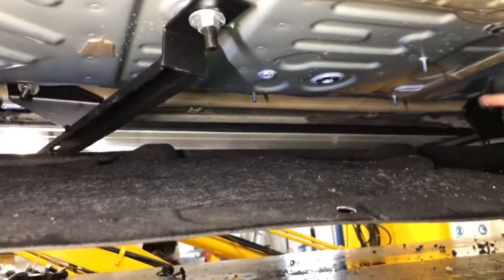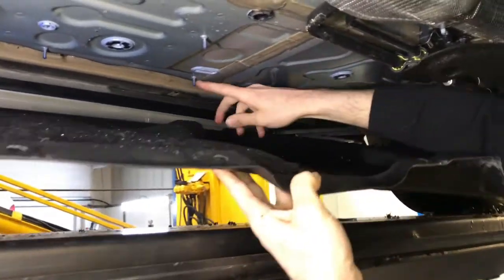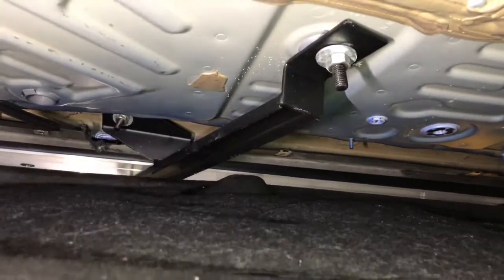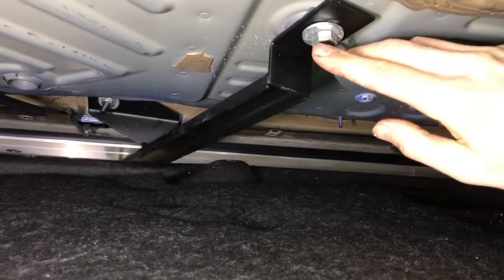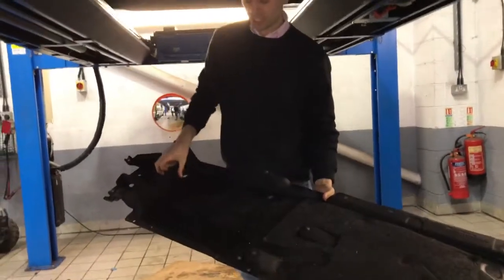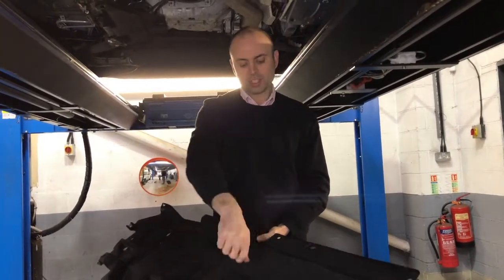Now, in this instance, depending on how many connections you've got and how many anchor points, obviously if you had some chalk in your hand here, you could line this up and then you'd have to mark where the bracket comes out, mark down there, and again with the middle bracket. So if I've lined this up like that, I would get some chalk and I would mark down here, up and across, so that this bracket's not in the way. So once that's down, those sections there are marked. I would get the cover down, and you get an angle grinder or a hacksaw or something along those lines, and just slice along, cut that section out, cut that section out, get a file and deburr it,